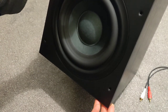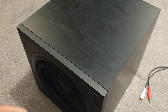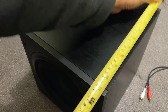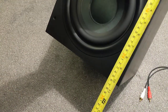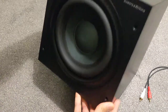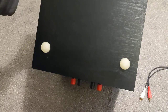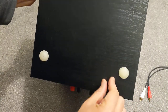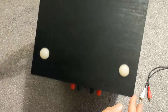I'm not going to open it up to see exactly how thick the MDF is, but I'd guess it's probably 12mm — don't quote me on that. The rough dimensions are approximately 280mm depth, 260mm width, and 260mm height without feet. The feet come with rubberized little bulbs that screw on, as opposed to the Cambridge Audio ones which are stuck on — and the glue on those melts and shifts around. These are solidly in place.